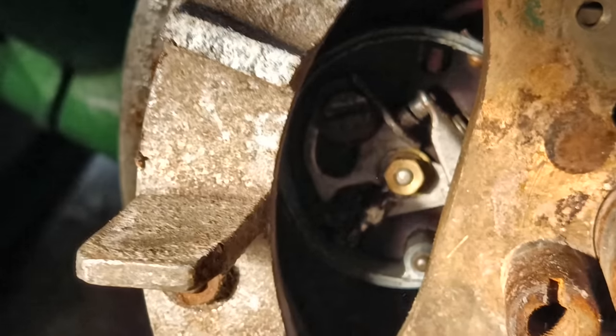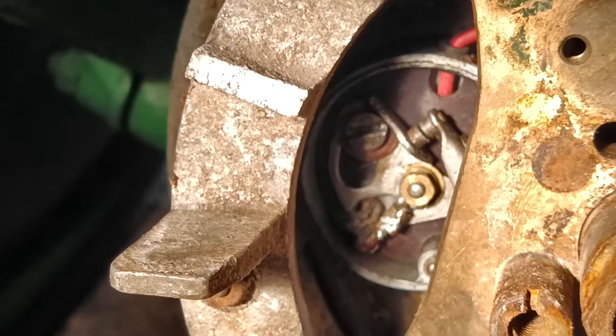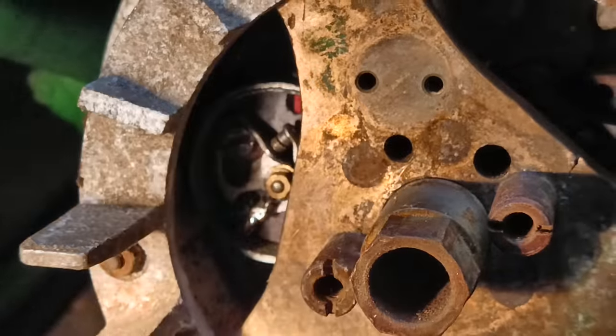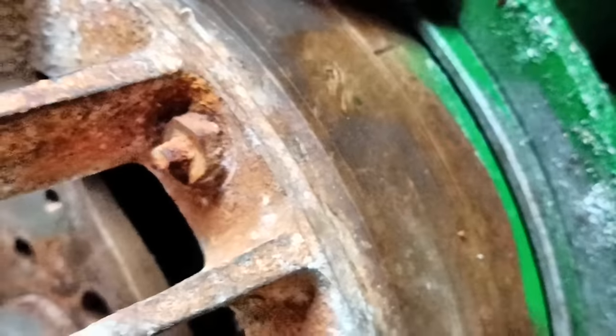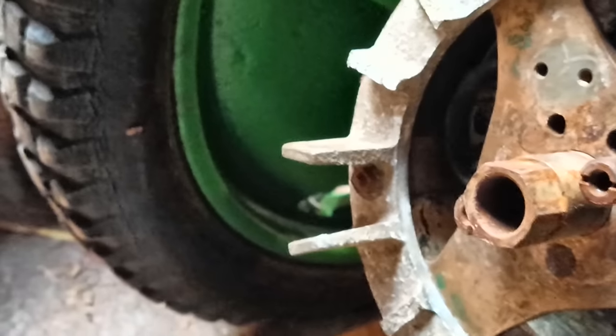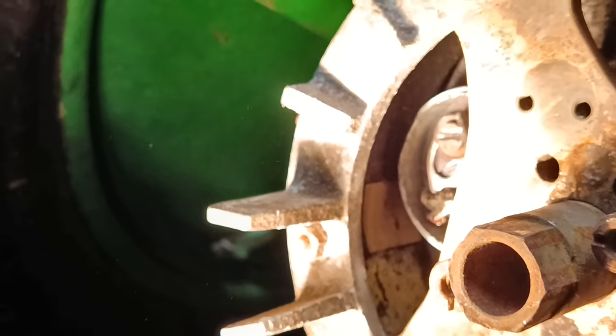It says the points gap should be the size of a standard postcard, and just before top dead centre — but I don't know how you figure that out. Would someone quickly send me a postcard? There's a mark there — is there a reference on the casing? I would guess that's top dead centre, which makes sense. It looks like a very thick standard postcard to me.